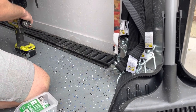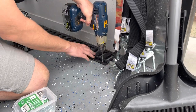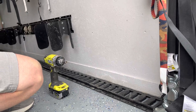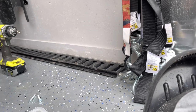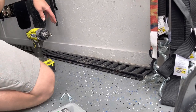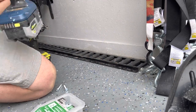Right here on this side, starting here, there's actually a metal plate all the way for about six inches right underneath the floor where this D-ring is hooked in. So I can put about three screws in right here and this will be a pretty secure area. I have a five-footer, a four-foot, and a four-foot. Ideally you want to get as long a piece as possible. Make sure each section has at least two studs it's sitting on, then align the holes to where the cross members are so you don't have to drill new holes through the metal.